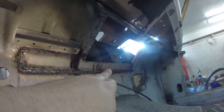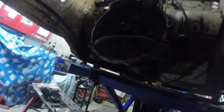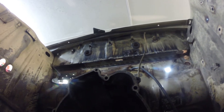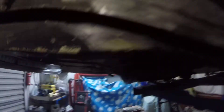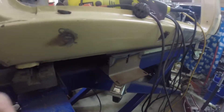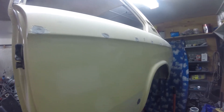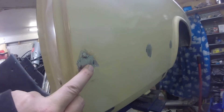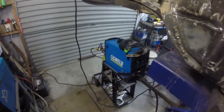Moving inside the car, this whole plate where the heater box goes in was replaced - there was a whole bunch of rot there. As part of that, the panel just under the lip on the firewall was also replaced - that's the outer skin and we still need to tidy that up. There was a patch put in just there, and we welded up holes on the inside of the engine bay to remove holes people had drilled for random bits and pieces. We've also welded up all the holes for the exterior panels - there was a kick panel along the bottom, and holes for the trim on the doors and rear quarter. We're not going with trim so we've deleted that, and there were plates put in along the bottom too.